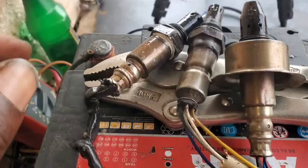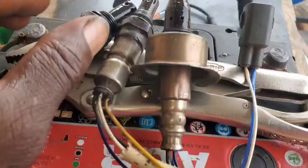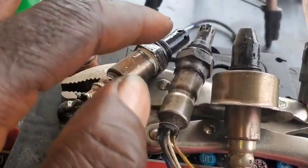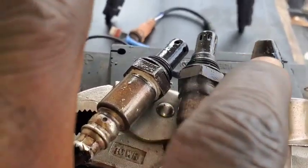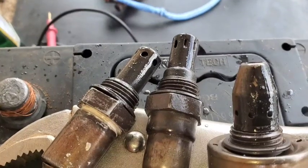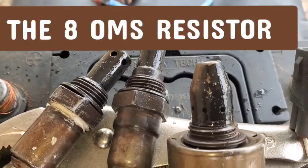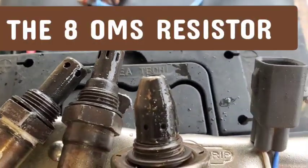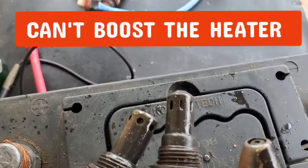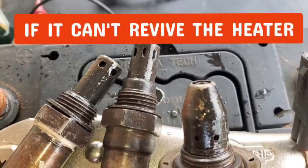It is not advisable to test with oil or to hold the sensors bare-handed the way I'm doing here — I don't have a thermometer available. Among the sensors, this one is responsive, this one is responsive, the one in the middle is responsive — however, the one on the far left is not responding adequately. It's not that it isn't heating at all, but it's very slow compared to the others from the Honda and the other vehicle. Normally it should get red hot.